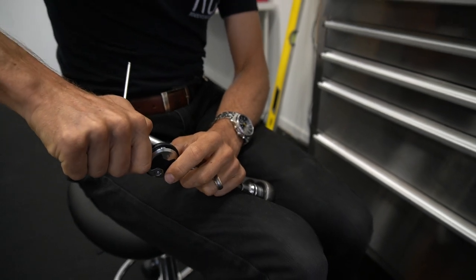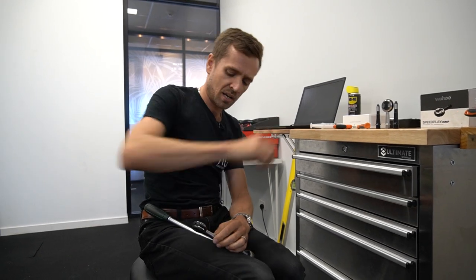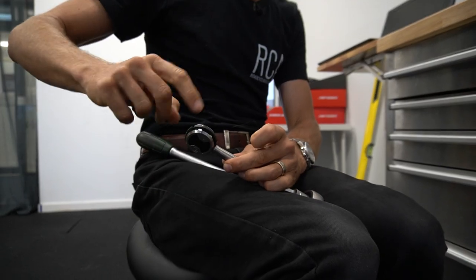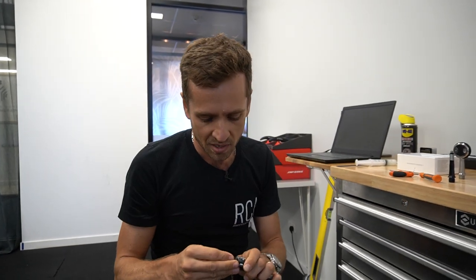The torque setting on this is an unknown — we've done a few of these now and haven't had them wind back out. Just go nice and solid. Make sure the pedal is a little bit stiff to turn on the shaft. It shouldn't keep spinning when you flick it — it should immediately stop. That's pretty dang good right there. Little rubber end cap goes back on.